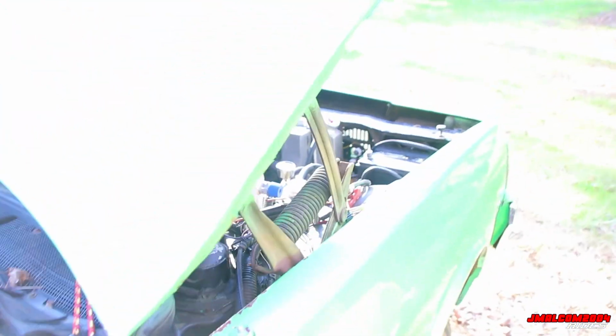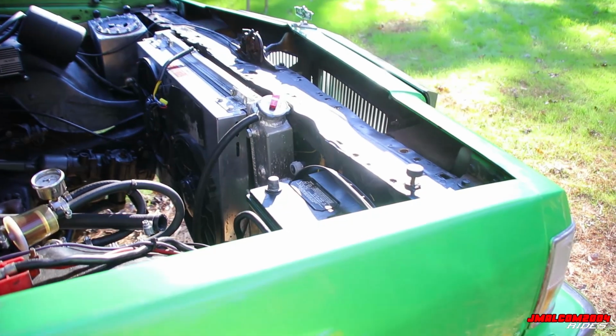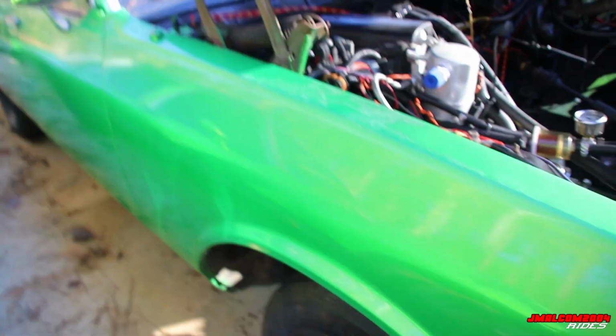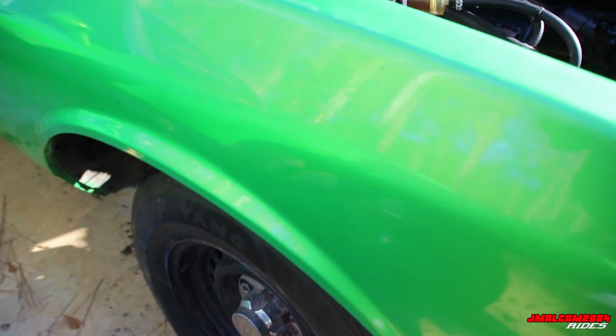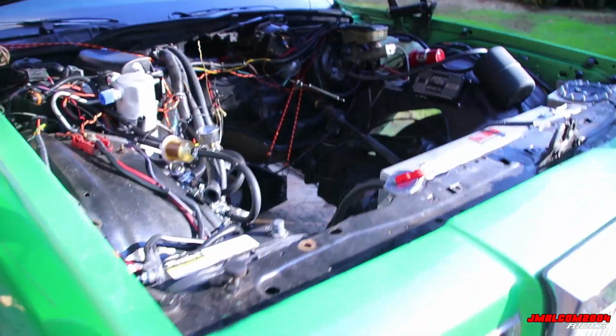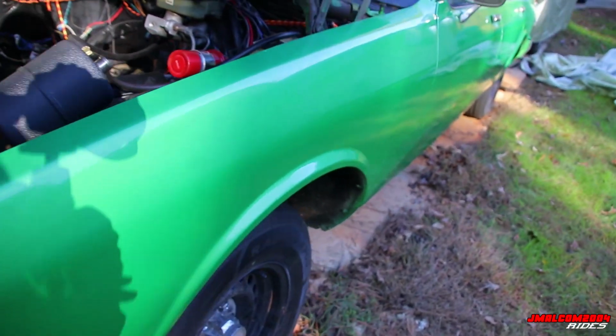And if this is a 9C1, you definitely want to check the suspension, cause they beat on these cars. So you want to check these real thoroughly. They beat on these cars, but you check the suspension, you push down. Mine's shot, I got race shocks on it, so it ain't gonna. And I got them set stiff, so you see it barely moves. It's not much travel, but check that. If the front end is bouncing all over the place, all the stuff is worn out.